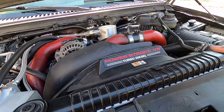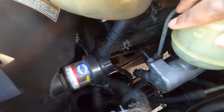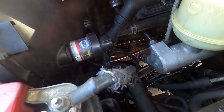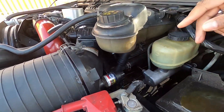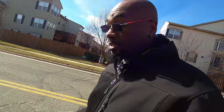These pipes were red when I bought the truck for $1,700 and it was already studded, which is a good benefit. If you look down on the driver's side you can see the 12-point nut head for the ARP studs down there — you can see them on a couple spots in that area, and on the passenger side as well. That's how you can tell if the truck is studded. All fluids were flushed, and the FICM was already brand new when I bought it — that's a big plus.